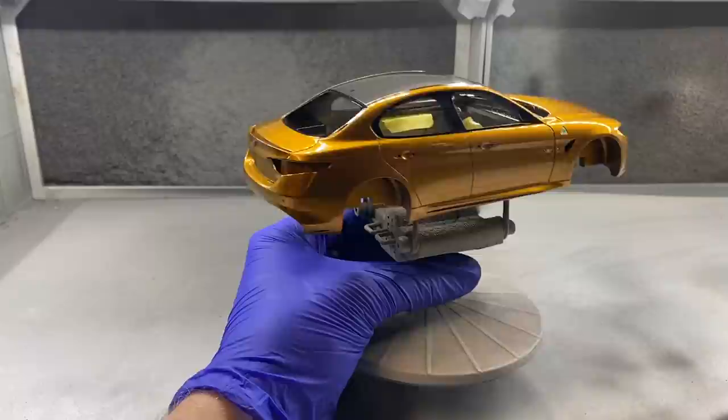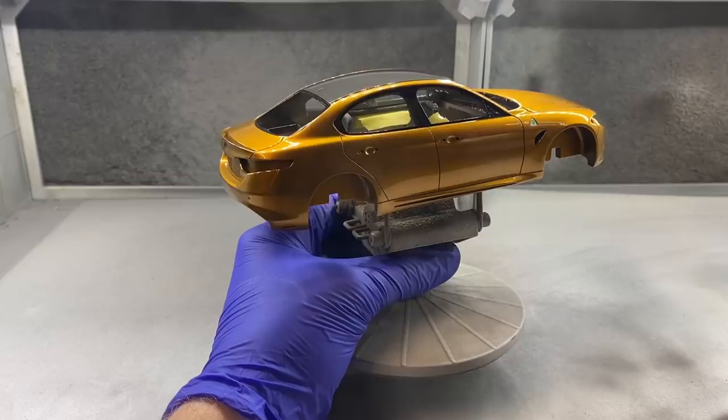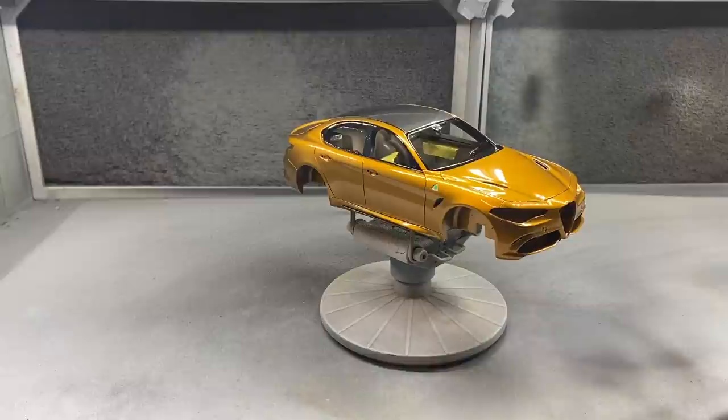The second coat is applied. I again let it flash off for about 5 minutes to move on to the third coat. Now, same with the second coat, you can add the thinners if you haven't already done that in that second coat for this third coat to lay down even smoother. I personally did not need to, as the clear coat was super nice and thin and sprayed and laid really, really well.